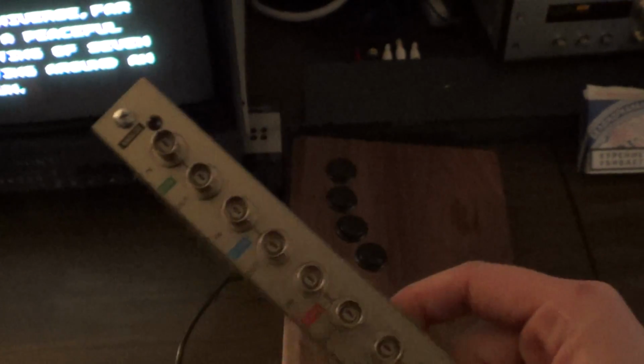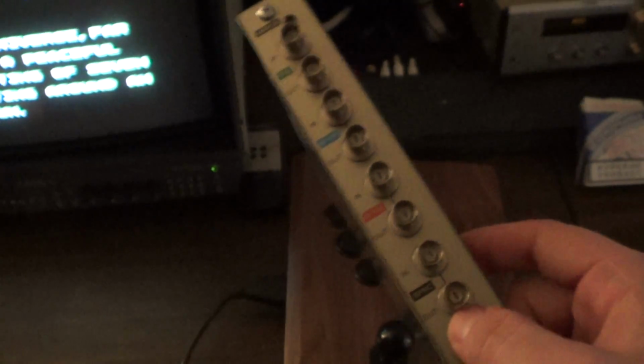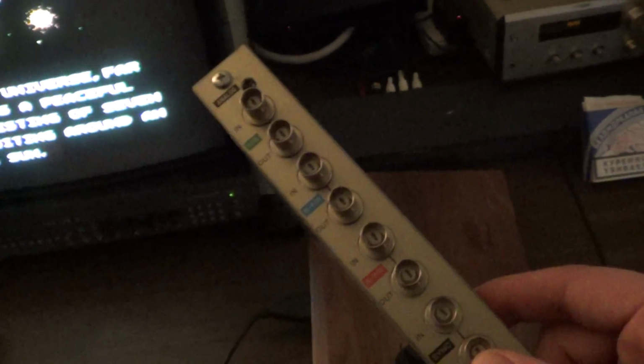In the back, you get one of these. And in the back of the 20FU, there's 4 expandable slots, so you can get these cards and put them in. So I recently picked up one that expands the component inputs, which is like the BKM-24N adapter, if anybody's really looking these up. So this is basically RGBS input through BNC connectors. So these aren't your normal phono inputs. These use a BNC connection, which is a lot more secure and supposedly a bit cleaner also.